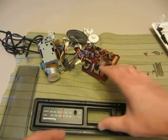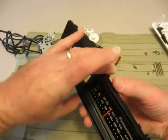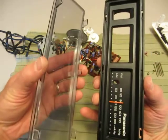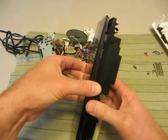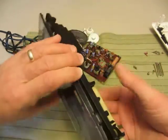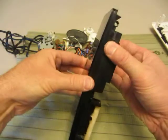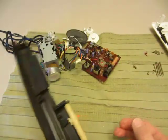We're going to take the radio dial and replace the glass face. There are three tabs on the bottom, so I know it goes in there — you can see the holes. The point is to take your time and gently rock things into place. If they don't go right away, back it out and start over, unless you don't care about breaking a tab. And just like that, it's in. We'll set that aside.